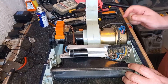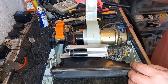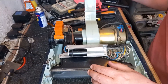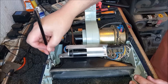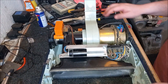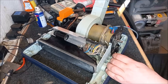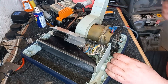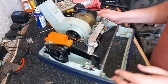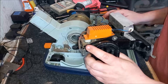I think what we should do is remove the motor — just take this out and run it out of the machine. Let's remove the ducting, which shouldn't be too tricky. There are some screws around here — one, two, three, four — plus two screws down here as well. So that's the ducting screws. All things being equal, the ducting should come away. Let's see — yes, there we go. So we take the ducting off.